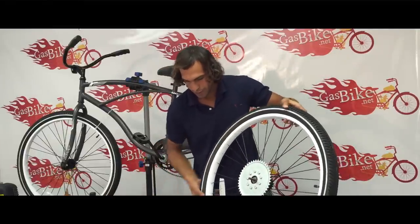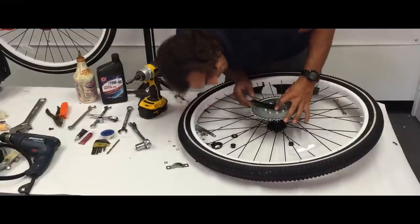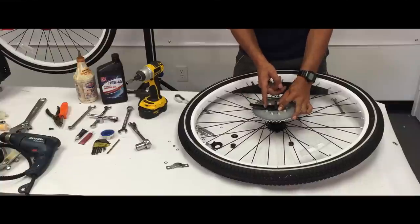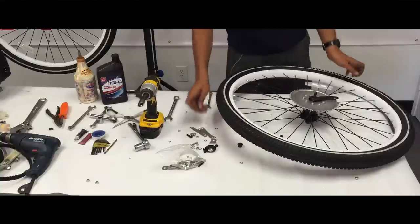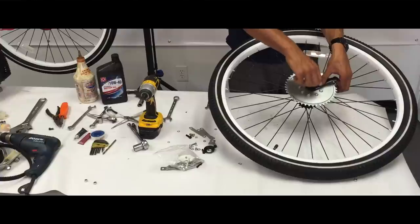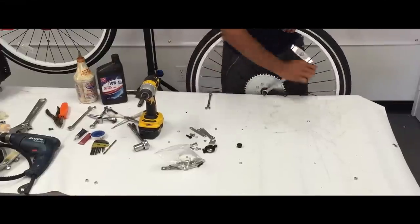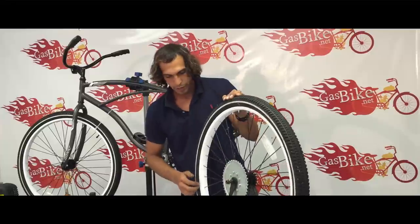So the next step is to reinstall the coaster brake arm. In this situation, we're having a little problem with the coaster brake hitting the bolts. So what we have to do is bend the arm here, and then bend it again here, so this part ends up in the same place as before. We're going to do this with a vise. Put the brake arm on, put your washer back, and the bigger nut. The easiest way to tighten it is to put it up against the table and tighten it like that. Make sure it's nice and snug, then add the next bolt back on, and you're ready to mount your wheel on.